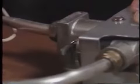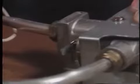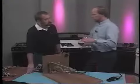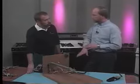I don't know how many times I've talked with a tech who says he's replaced the glow bar, replaced the valve, the glow bar again, and the thing still doesn't work, only to find that this shutoff valve is turned off. If it doesn't have an indication of whether it's on or off, does it? No, it doesn't. A good indication that it's turned off: the symptom on a double burner model is that neither burner will work. Okay. This has no effect whatsoever on the top burner, strictly the oven burner.